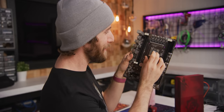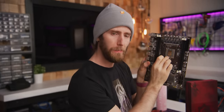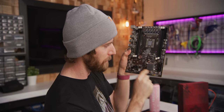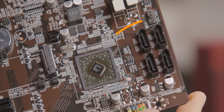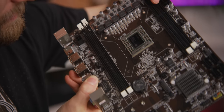Where do I even start? This thing is so weird. We've got our CPU — but actually it's the CPU, GPU, and more. It's more of an SoC, except that the board does have some kind of Southbridge chipset that probably handles things like these SATA ports. This is also an AMD chip. It's got DDR3 memory, four slots, probably dual channel.